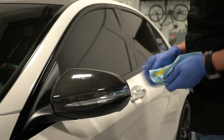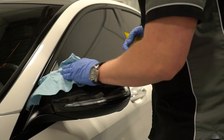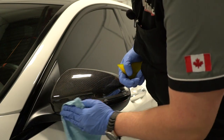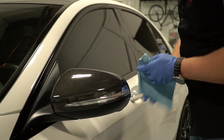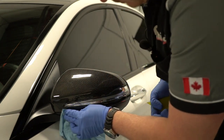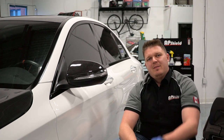And there we have it — the driver side mirror is all protected. What I normally do is dry off the edges with a towel and let the mirror sit for about 10 to 15 minutes. That way the towel absorbs all moisture, it air dries, and once I go over it once again with the towel it tacks down 100%. Hit the subscribe button below — I'll be posting a lot more tutorials on how to wrap your car like a pro. Thank you.